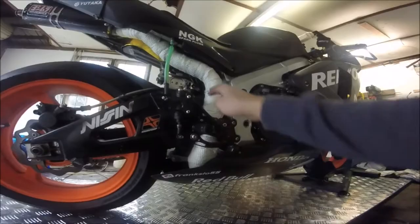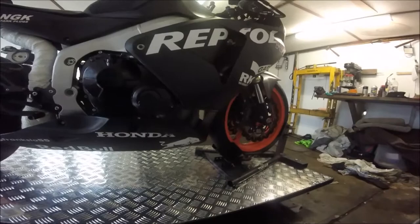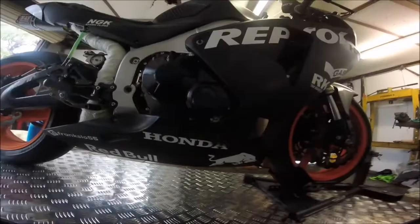Re-wrapped the exhaust all the way, resealed this case, fresh oil and filter, cleaned the wheels as much as I could, and yes. Cleaned everything up, re-fiberglassed the bottom, just fixed things here and there. So,